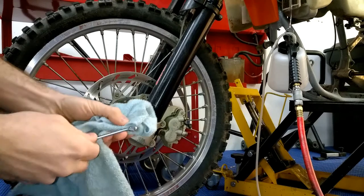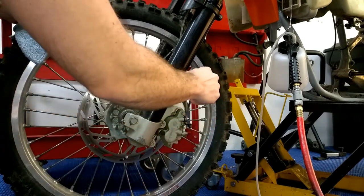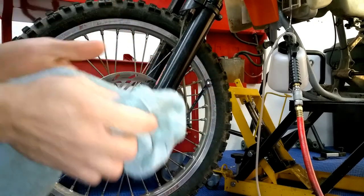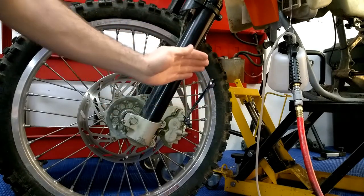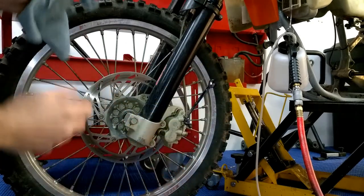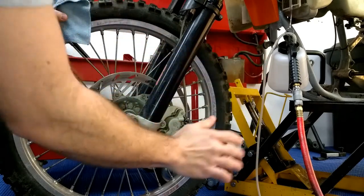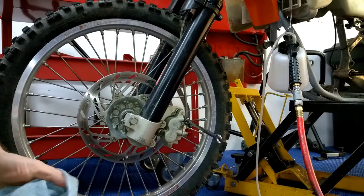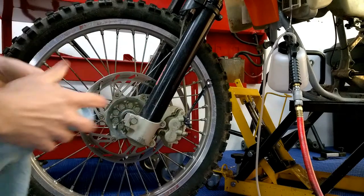Now this bike runs an 11 millimeter. I already tested it before I did it. And you want to get it on there, and you want to make sure that you get it on as high up as possible on the tool. So when you open this brake bleeder screw, you want to get it open as far as possible, because if you put it on farther down and crank it open, it won't allow as much air into the system and it will take longer. So go ahead and get your wrench on there as far as you can,